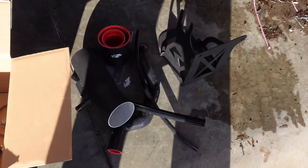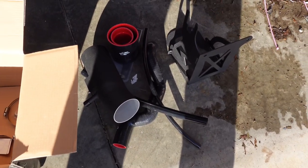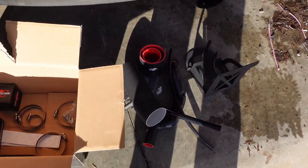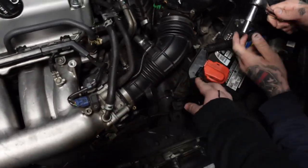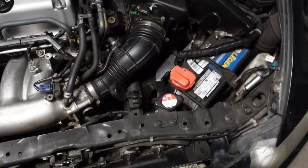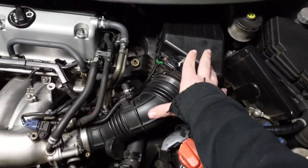It's a pretty good kit overall. I've had some good experiences with K-Tuned and some not so great ones, so let's see how this goes. All right, engine bay is open with the stock intake. First step is we're going to be removing the battery because it's going to be relocated — the intake is going to be sitting where the battery is. So we'll take the battery out, take the intake off. Don't forget your MAF sensor and some lines.